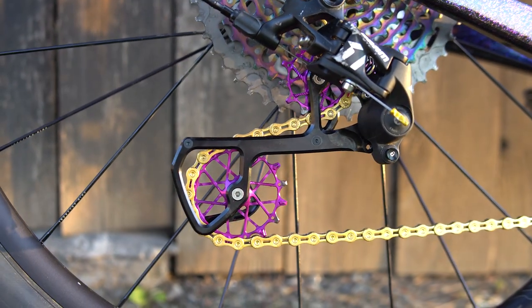If you don't feel comfortable modifying the cage yourself, you could take it to a local bike shop — you'd probably want to show them the link since most won't know about it. But realistically, if you look at their tutorial and take your time, and again be careful because of the clock spring, I think anybody with just a basic set of allen keys can do this themselves. I'd definitely recommend this if you're trying to breathe new gearing or life into your current bike. If you've got a medium or short cage rear derailleur for your Rival or Force 1x setup, this is a great way to add extended range, especially if you jumped on the gravel trend before the massive mega-range cassettes came out.